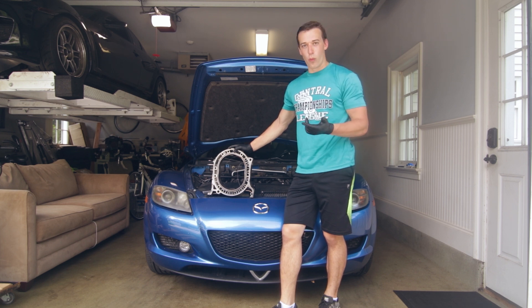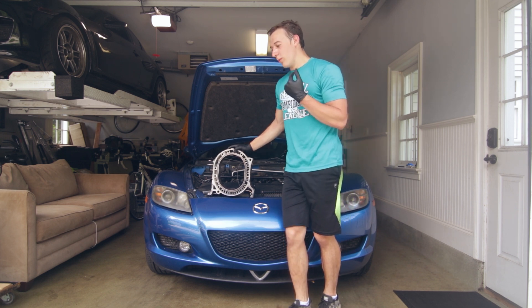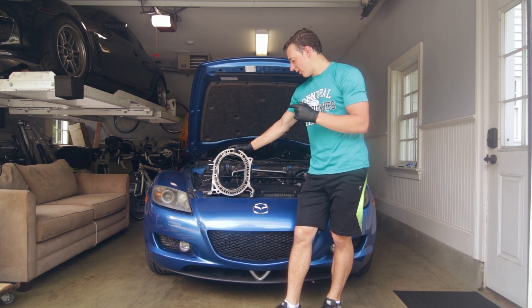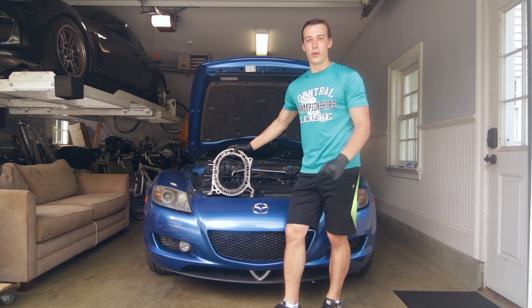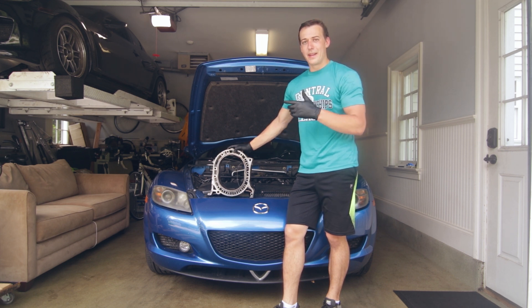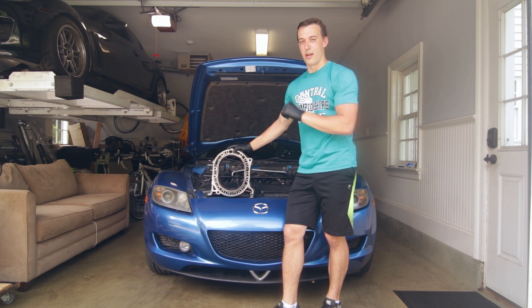But if you only really want to run one for space or cost, I choose the water temperature because, one, since it's going around this engine you're getting an accurate reading of your engine temperature. Two, the coolant sensors love to fail on RX-8s. My track RX-8's coolant sensor is completely shot and the coolant light is always lit on the dash, and this one has popped up a few times even though I know the coolant reservoir is full. By getting a water temperature sensor and monitoring the temperature, if something wonky happens you'll actually know you're low on coolant.